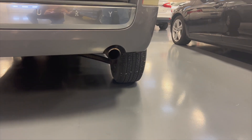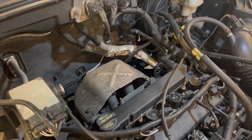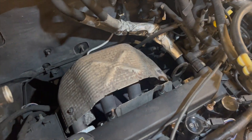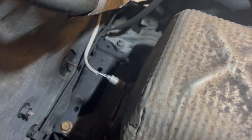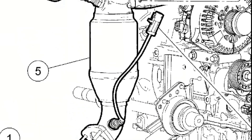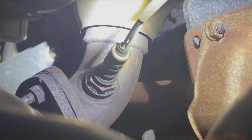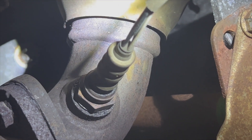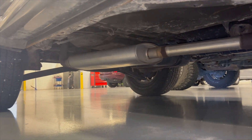We started with a quick overview on the entire exhaust system to locate the catalytic converter. The major parts of the exhaust system in this vehicle were the exhaust manifold, the upstream Bank 1 Sensor 1 O2 sensor, the exhaust manifold pre-catalytic converter, the flex pipe, the downstream Bank 1 Sensor 2 O2 sensor, the second catalytic converter, exhaust pipe, resonator, and the muffler.